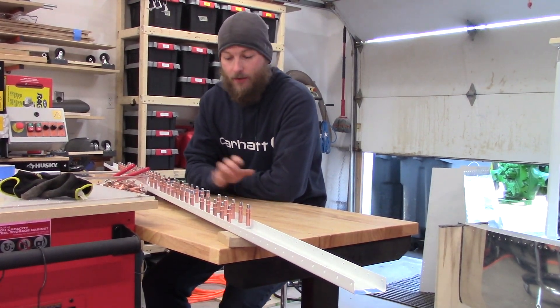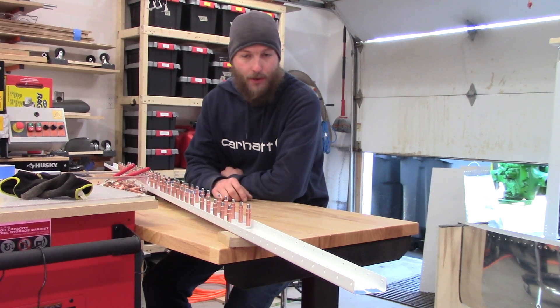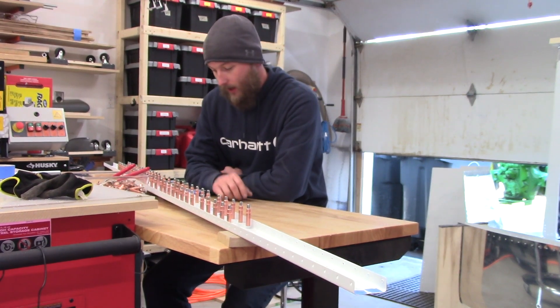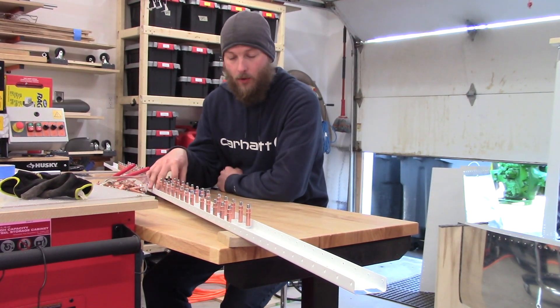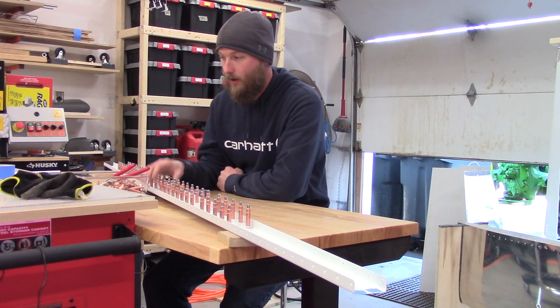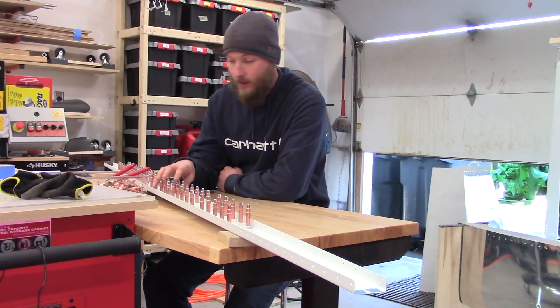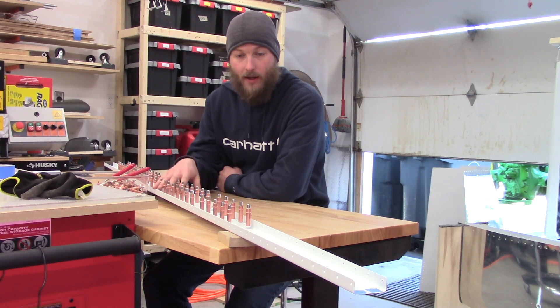Here's what you missed: I've already primed all of the assemblies for the horizontal stabilizer off camera to avoid overspray on the camera. I finished marking up all the holes called out in the plans to not rivet on the rear spar assembly, and I've clecoed all the pieces together. Now I'm going to review the plans, determine the correct rivet sizes, and get started with final assembly for the rear spar.